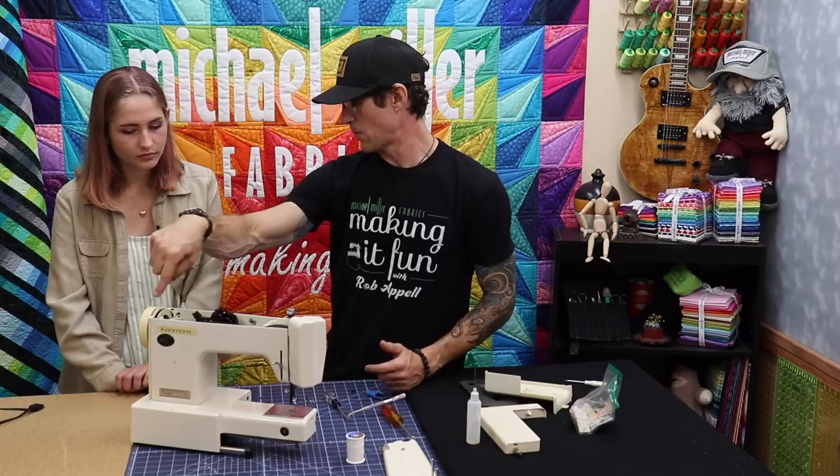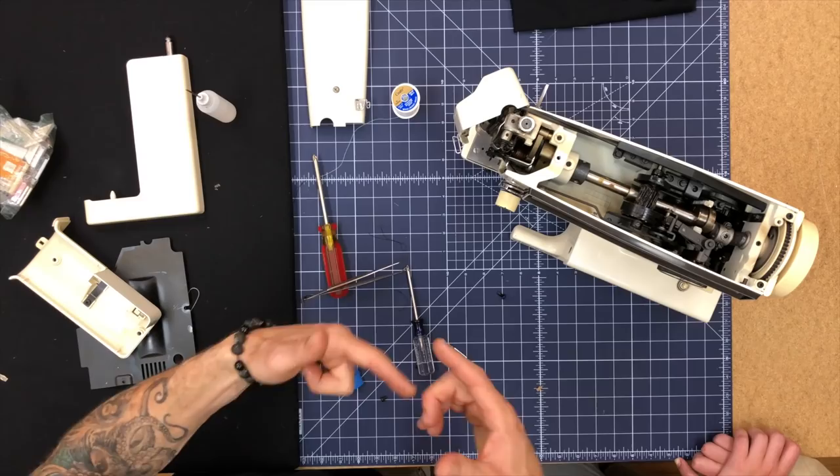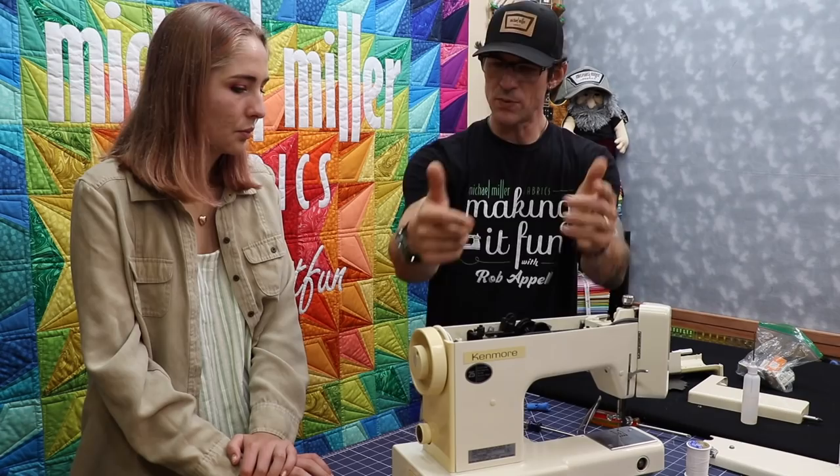so the bobbin can be wound on the mechanism that sits against this. So we want to loosen this, but when I loosen that, that means the motor should be free and not feel stiff. It didn't change much. Go ahead and experience that for yourself, if you will. Doesn't feel much looser, right? No. It should have. Because if this upper part was sticky, when we disengage the pieces that are moving around, see now none of this is moving, mm-hmm. It's still kind of sticky.